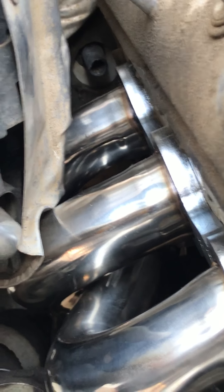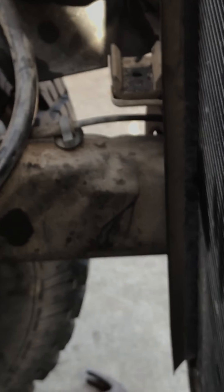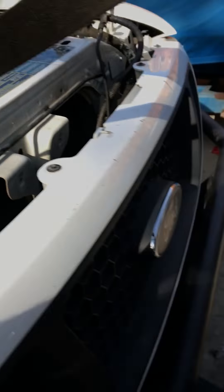I can lower the front of the motor like a half an inch — it's right under there. Remember that this metal sheathing has about a half inch of play behind it, so once I lower the motor a little bit more we'll have a little better clearance. You can see down in there that the header is just tapping that, so we'll round that out a little bit.